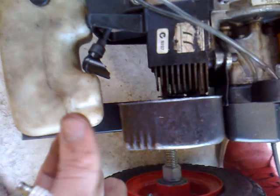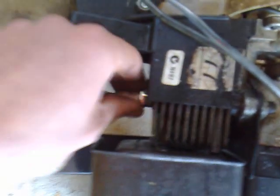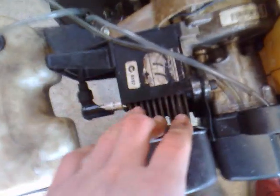That's sparking nicely, so I know that's all good. I'll take that out, pump it back in — I might give it a few cranks over just to get some of that oil out of the cylinder. I'm definitely running too high or too low of a ratio. Then I'll chuck it back in and try to get it started. Don't do the spark plug up too tight — just tight, not too tight. You'll strip it; it's only aluminium in here. If you're too tight you strip it out and that's basically the end — you need a new engine or just a new head.